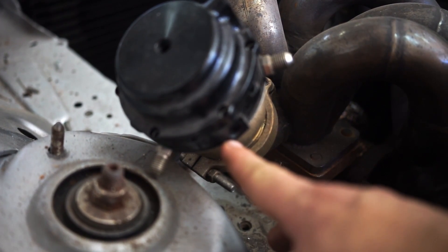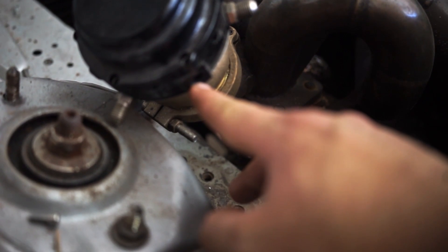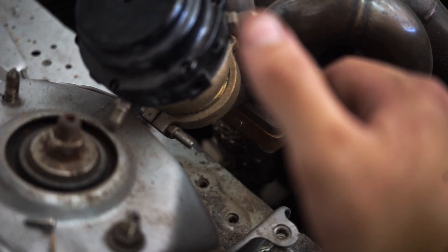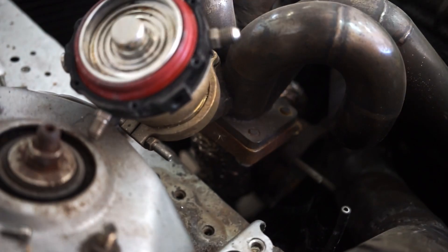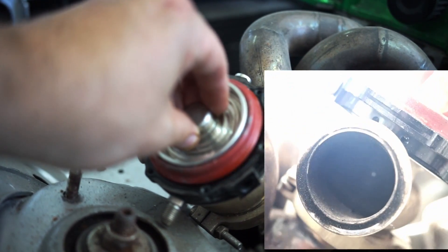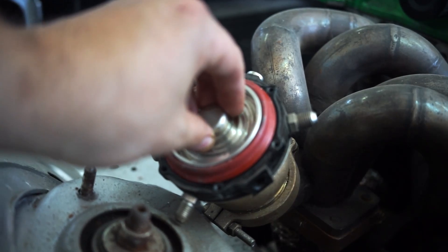Every port that has access to air and is not for water cooling should be blocked off. Here you have to screw in your barb to use your boost control line — this is where the line goes — and that goes either, if you want to run wastegate pressure, to a boost source such as the intake manifold, intercooler piping, or the turbocharger. This pushes the diaphragm; normally the spring is in there, and as soon as the boost pressure overcomes the spring pressure, the diaphragm is pushed up and the valve opens, so your wastegate opens.